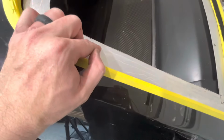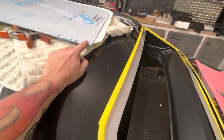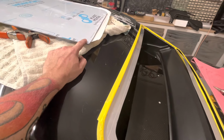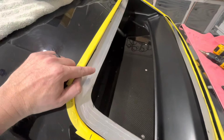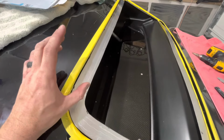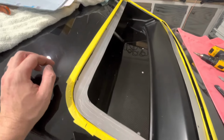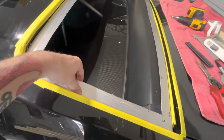And the aluminum is gonna be easier to drill into, meaning my plan is to drill this, countersink this, and then use wood screws. Pre-drilled aluminum and a wood screw should bite the aluminum enough to pull this down where you don't have to do anything crazy, and then we should be able to just rivet this outside in. That's my goal.